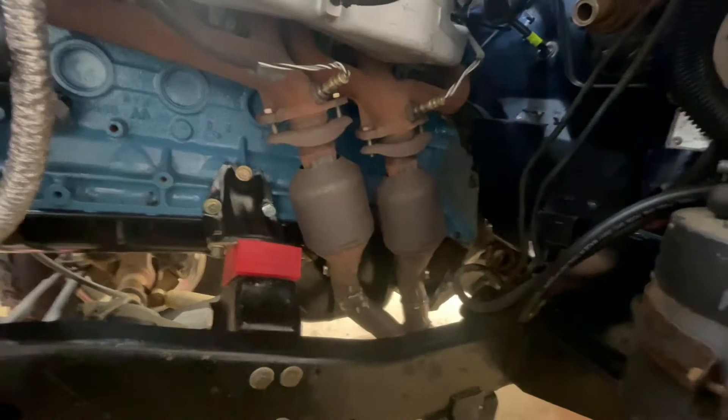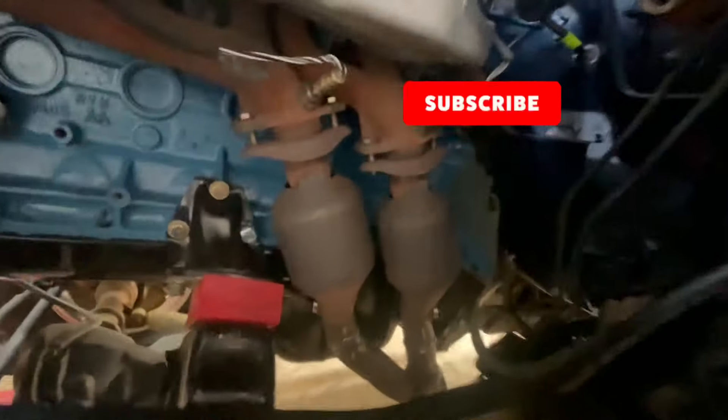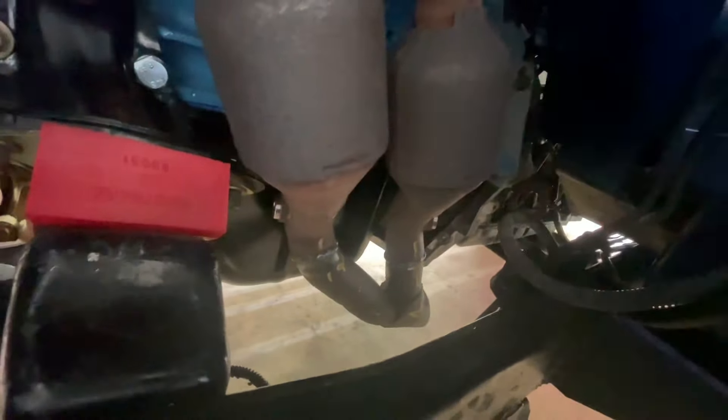We got them in there, they're sort of tightened up. It looks like I've got the angle of the flange where I want it so I can weld that other pipe in. I'm going to go ahead and tack that other pipe in, pull it all back out again, and then weld it up. This has been fun, so bear with me.